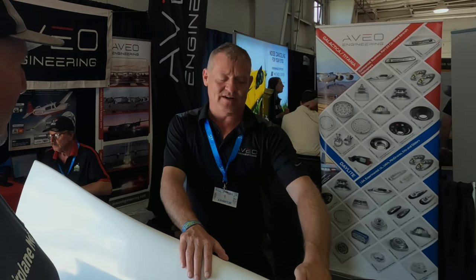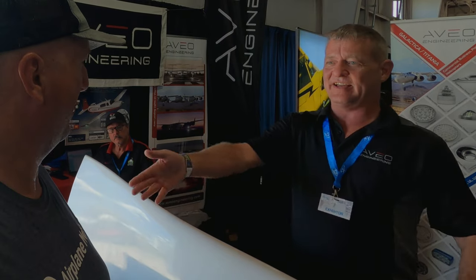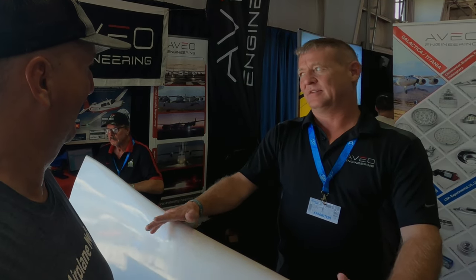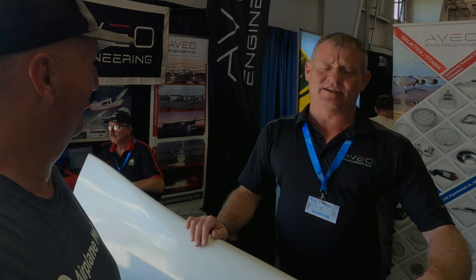configuration where you have landing taxi, wig-wag recognition, red and green strobe, rear position, rear strobe, but we're gonna have some tail illumination, some ground illumination. Maybe we can just say, hey, it's Bill's RV-10 on the ground, just like Mercedes does when you open the door. And then also, when the warp speed project comes up, we're gonna have a really powerful taxi light, which will wigwag at 28 mile visibility, which is insane. If we could get it in here, we might be able to. We're working on it. We think we can.